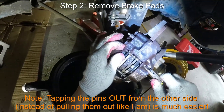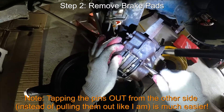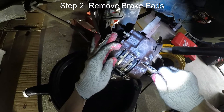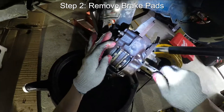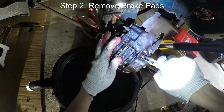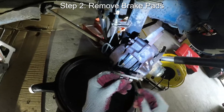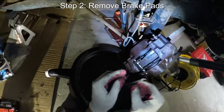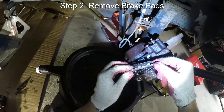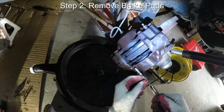Next is taking out these pins. This one you can manhandle a little bit because, as you know, we already have all new hardware for this caliper, so just take a pair of pliers. What just came flying out was the brake pad retainer clip — it sits right there. So we're going to take this one out; here's a pin that just came out. And here's the other brake pad clip. Last thing is this last one, which comes out really easily.